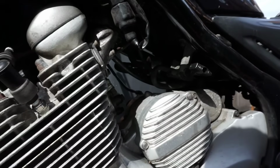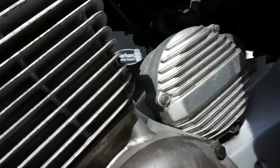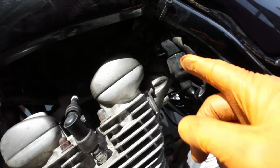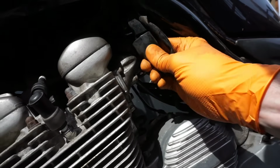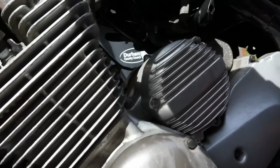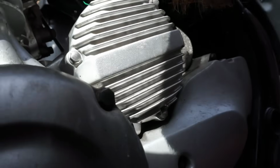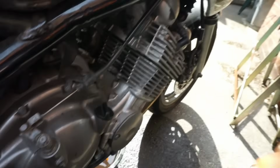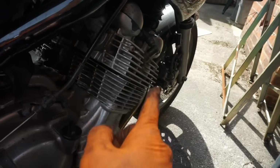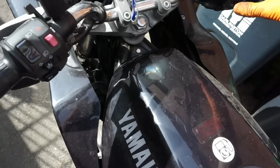I'm gonna have to stop the fuel pump from pumping, unfortunately, because it's flooding one of the carbs on the right side. So I'm going to turn the fuel pump off. Try to find the wiring for it. Right, so I think on this side the carbs are overflowing, so I've disconnected the fuel pump so we're not going to get too much fuel. And now we can start it without worrying about petrol pouring out the top of the engine.